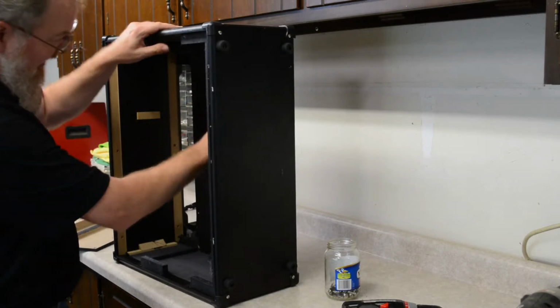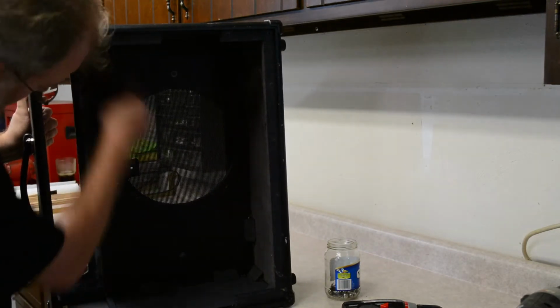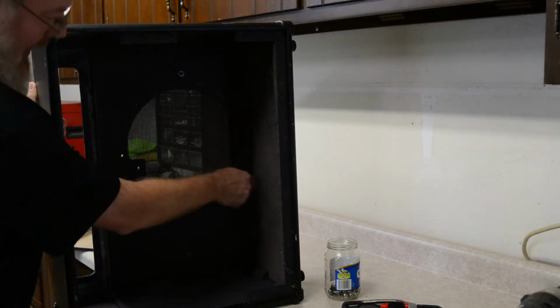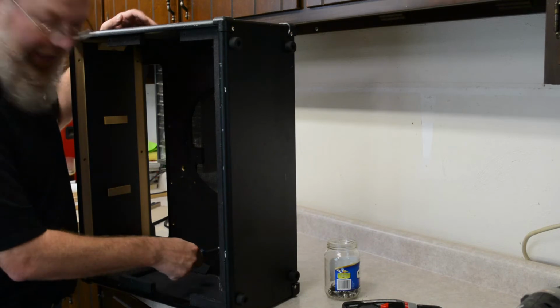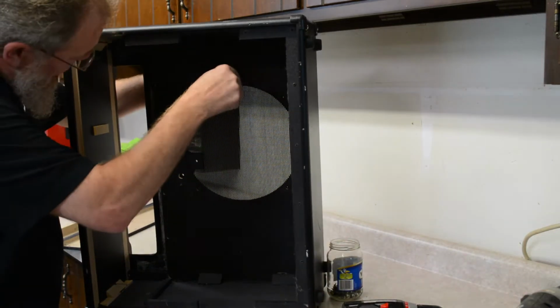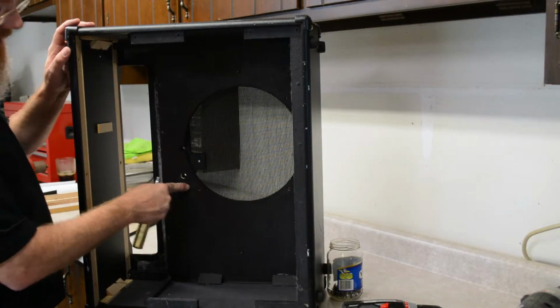So it is still not free. Why is it not free? So I've taken, well, there's 1, 2, 3, 4, 5, 6, 7, 8, 9, 10 screws out that don't seem to be releasing anything, and those 3 little screws out that take the logo off. But now we've got a nut right here. Looks like 3/16. Well, this is a Japanese amp. It wouldn't be 3/16. Maybe, will 7/32 fit it? Yes. These are metric, but my 7/32 is grabbing it pretty nicely. So I'm going to take these 2 nuts off. There's one here, and there's one here. Why did they do that? Oh, wait a second. I found 2 more. Then there's another one here, and another one here.